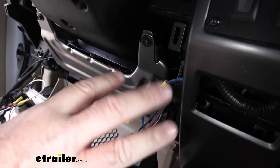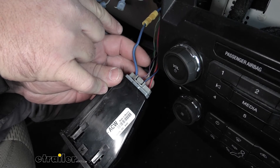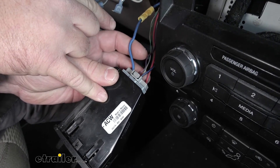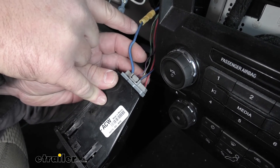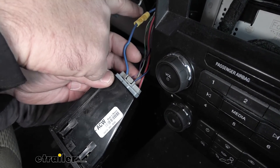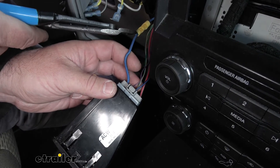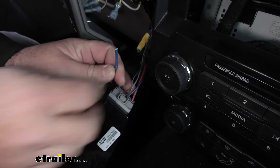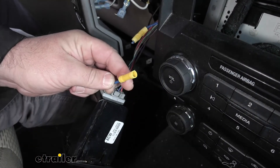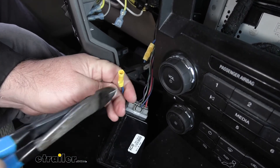Now once we get that connection, we can go ahead and put our dash back together. However, where we hooked our black wire into our blue wire coming off our brake controller, it's causing a little bit of interference. Our customer is not going to actually use the brake controller — he's not going to pull trailers, he just pulls the vehicle. So what we're going to do is cut this blue wire on the brake controller side and cap it off in case they want to reconnect it later on. If you're wanting to keep your brake controller, the black wire is not going to be able to be connected here — you're going to have to run it to the back to the seven-pole plug and hook it to the brake wire because of that extra signal going in from the brake controller. So because we're not using a brake controller, we're just going to cut this off here, strip it back, add a butt connector so that if they ever want to re-hook it back up it'll be ready and they'll just have to strip back the other side.